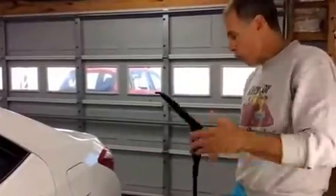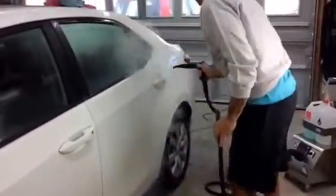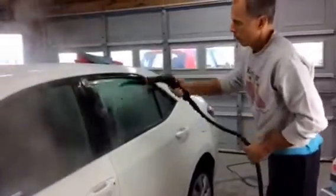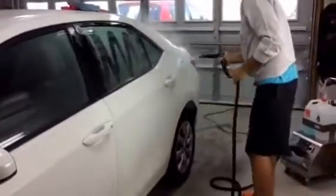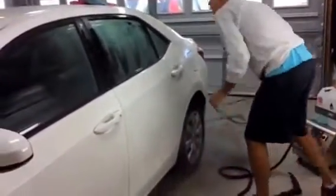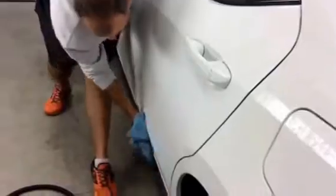With that I'll start now — just watch me do the side of the car as if I'm really washing it. Releasing the dirt from the cracks and crevices and spraying some of our waterless wash product on the car allowed the dirt to be released from the seams and the cracks and crevices. I have enough waterless wash on the body to actually wipe it down with the microfiber towel without scratching it.